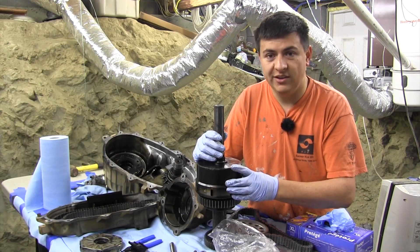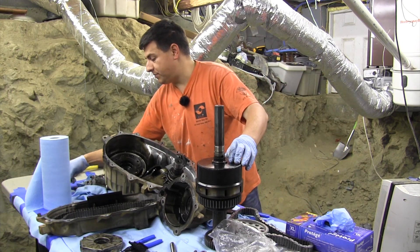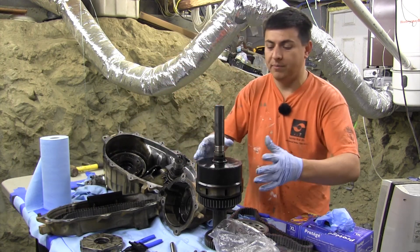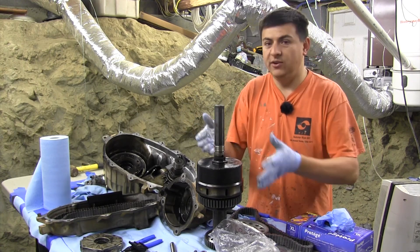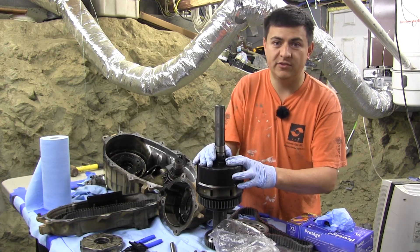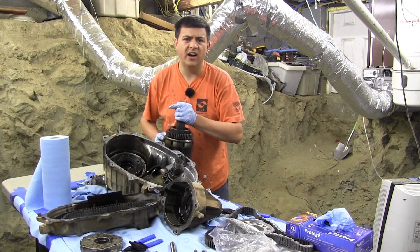Tonight's conundrum is that this Verilock unit is firmly attached to this main shaft, and I wasn't really clear on how it's supposed to be attached. All the instructions simply say 'remove' — you're supposed to just remove the snap ring holding this onto the main shaft and then supposedly it just pops right off, although it hasn't popped right off for us. Every set of instructions we could find simply says 'remove' without telling you how. All the forums I could find didn't really have a clear answer either, because a lot of people aren't adventurous enough to pop open their transfer case.